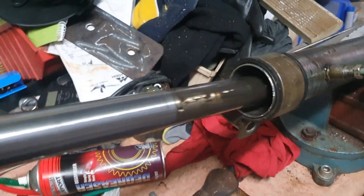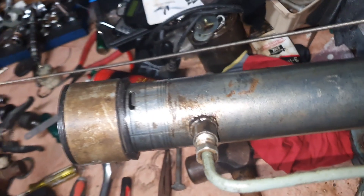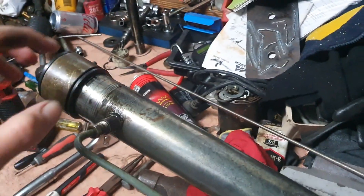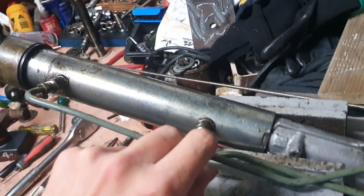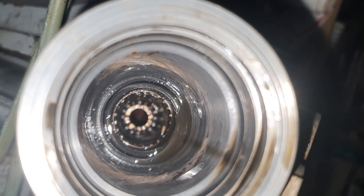So now we can pull this out. Rack and seal there, and looks like we have another seal way down there in where the dry part of the rack is. So that would be the seal from this part, which is the wet part, to the mechanical part down here. Okay, so this part of the steering rack is the wet part — there's a seal there and a seal there. The lines pump the fluid to the other wet part up here; there's a seal at the top and a seal down the bottom. That part has grease in it, so that is one of the seals in there down the bottom.